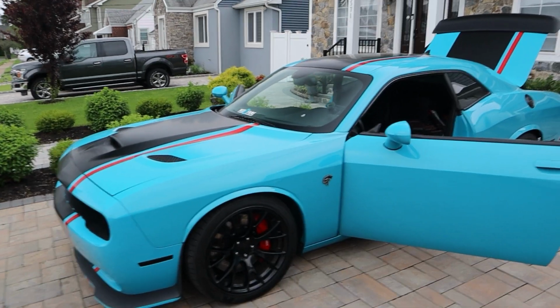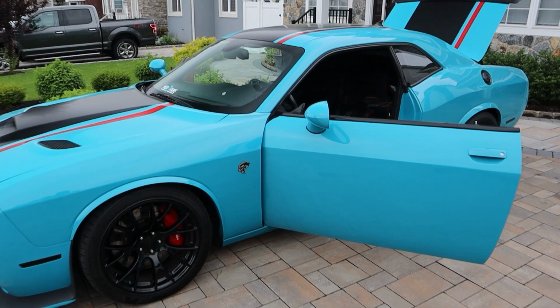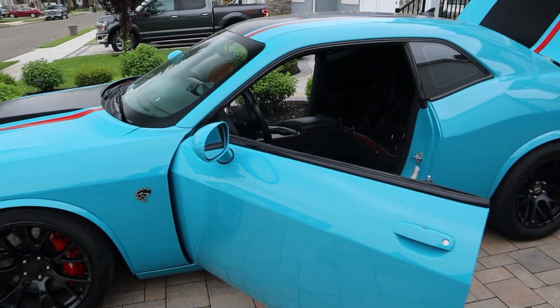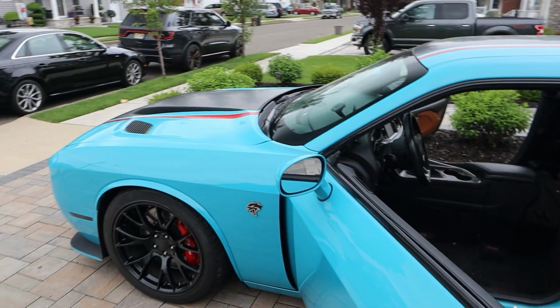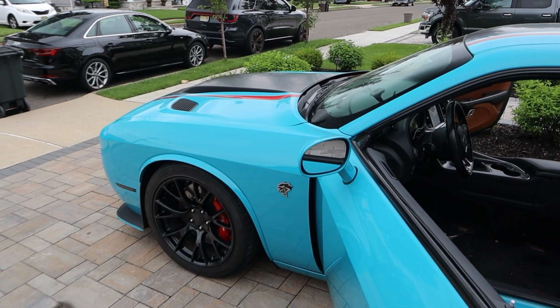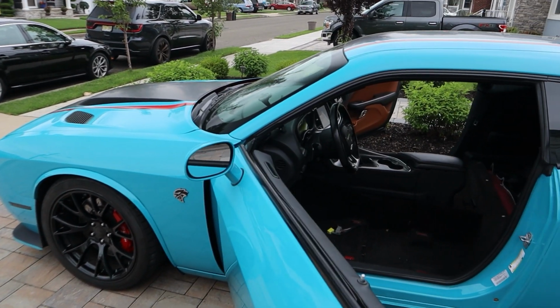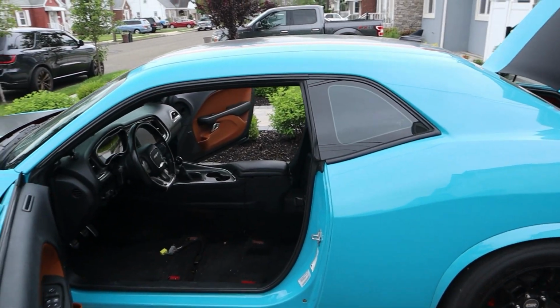What we're gonna do is put 18 by 5 inch wheels in the front. We're gonna run some skinnies in the front. We're gonna reduce a lot of rotational weight. On average, we should probably be looking to drop a total of about 30 pounds just with that.